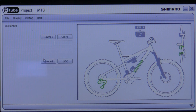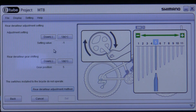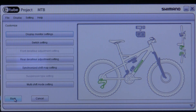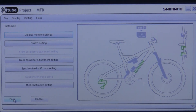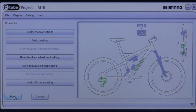You can also go into rear derailleur adjustment. When initially setting up the bike, instead of doing it from the display unit, you can do it from the computer and get your cog perfectly aligned with the rear derailleur for accurate shifting — it's just a bit easier on the computer. So that's basically a quick overview of how to use the SMPCE-1 device to connect your laptop or computer to the Di2 system.